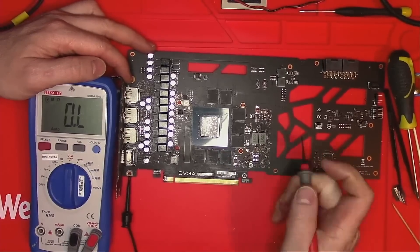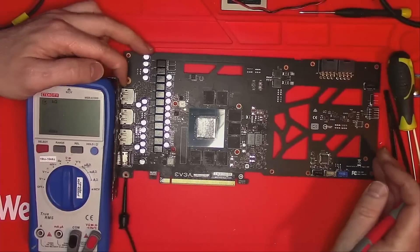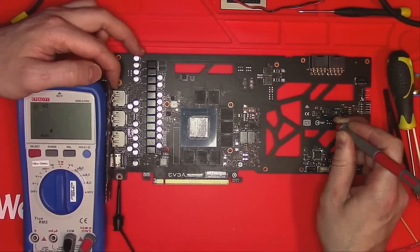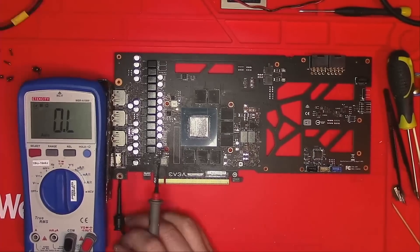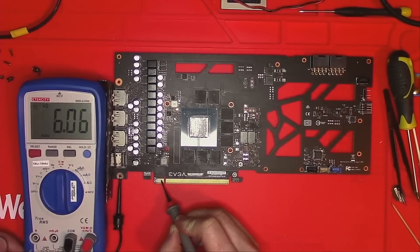This is Samsung so that's normal. This 5 volt inductor has several kilo ohms and this one here is the same. 3.3 volt with 6k.